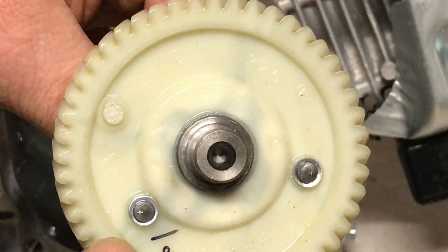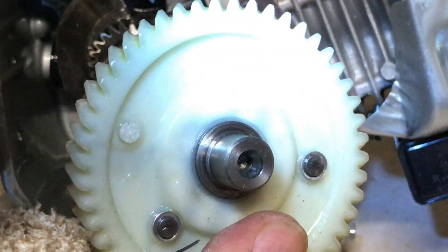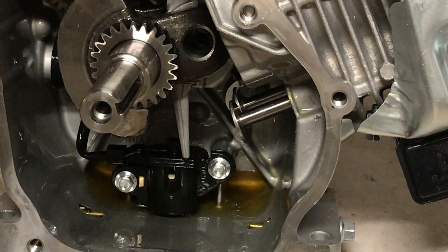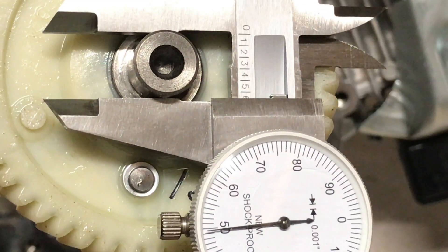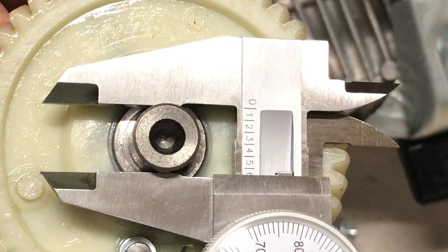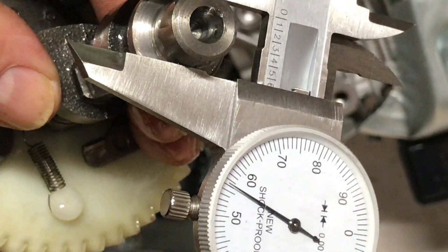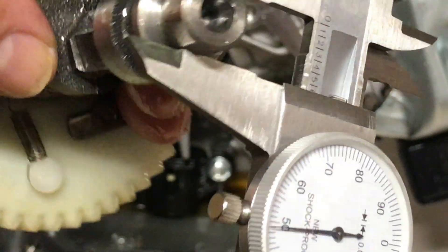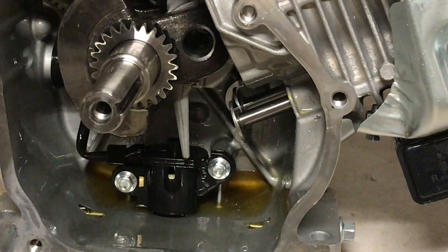225 — you can't really make it out against the white there. Wait — this is a glow-in-the-dark camshaft. Yeah, that's fluorescent. Let's see what we're going to measure out here — 549 thousandths on the camshaft main shaft. That is a clone camshaft. The cam's been clearanced for the stroker crank. 549 thousandths — that is a clearanced clone camshaft.